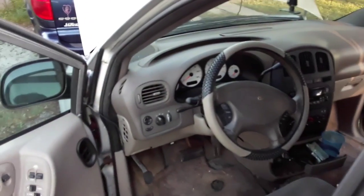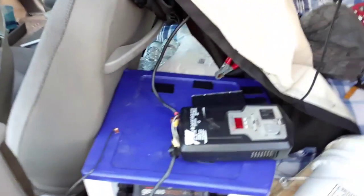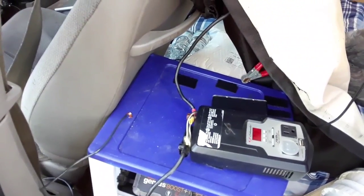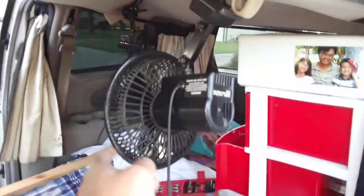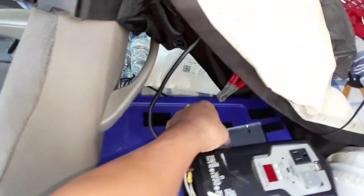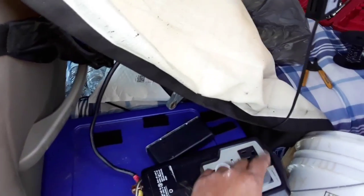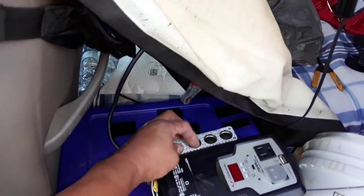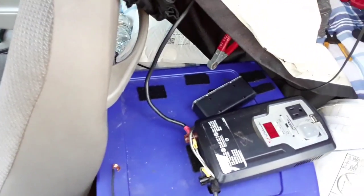If that works, I can use 120 volts right now using the vehicle starter battery as both starter and house battery. The reason we don't want to keep it like that long term is we want the system to run with the van off without the motor running. That way I can run the fans — I've installed two fans here — at night if I need them, and I can charge via USB port or run other 12 volt devices off these connections.